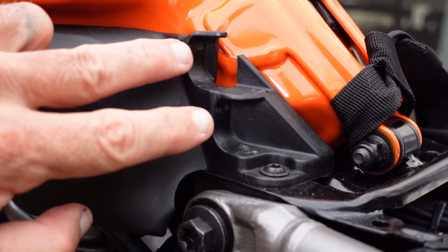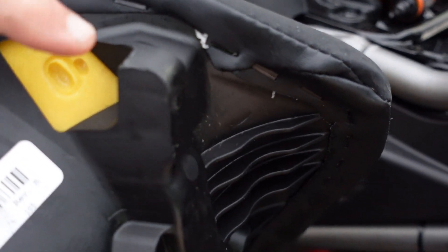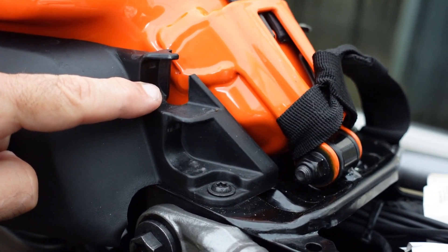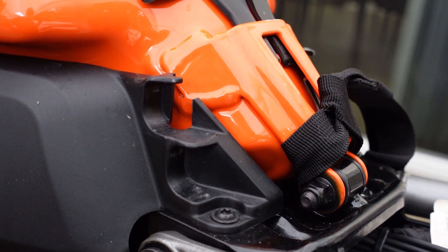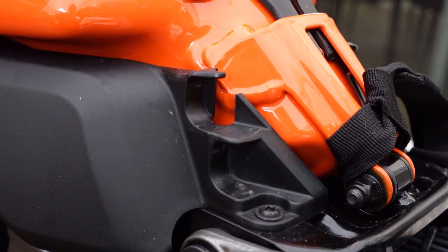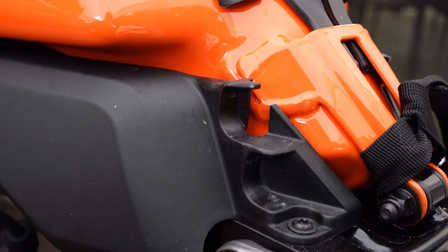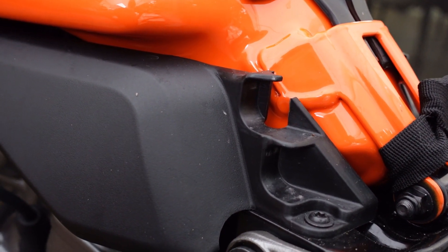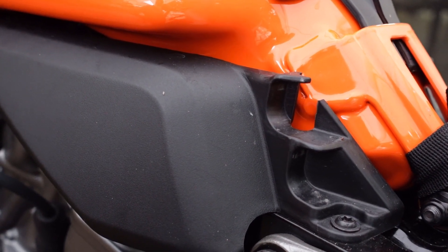While we have the seat off, I'm going to point out these two notches right here — this is how you set the seat high or low. In the front of the seat, this round tab here goes into the two notches, one on each side. You put them into the high notch, that's the high position. Put them into the low notch, it's the low position. It's just that simple. I've ridden the bike both ways — I rode the first Saddlesore 1000 with it in the high position and the second one in the low position. Anytime I decide I want to switch it up, like if I'm doing a long distance ride and I get tired of one position, it's a simple matter to just pop the seat, put it in the other notch and go. It does not change it a whole lot, but if you've been sitting in one position for eight or ten hours, changing to the other position actually does make a difference.